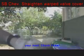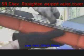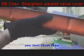Well, I went ahead and took my valve covers back off, and I'm checking the rails for straightness. For instance, we see right here, look for daylight underneath there, and I see that this whole area is high. We like to hammer these down with a ball peen in these holes, but this whole area, they're just warped. So I've taken off these really trick Moroso gaskets, real thick and firm.